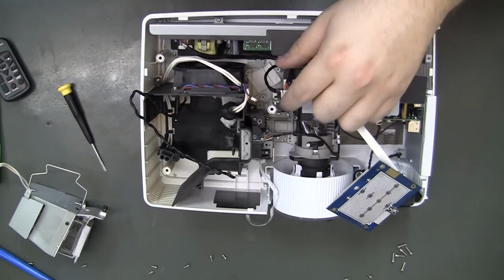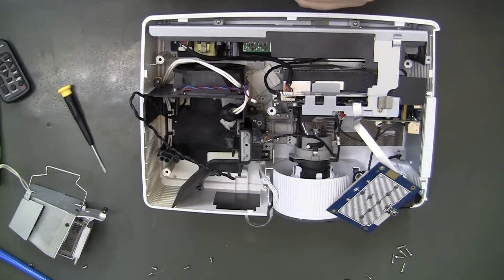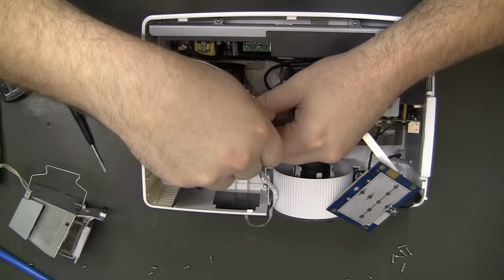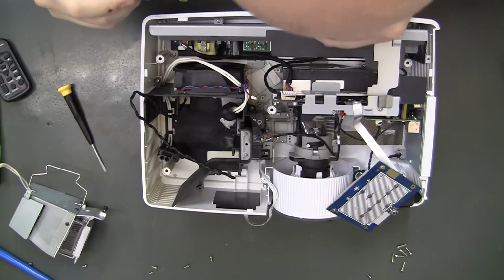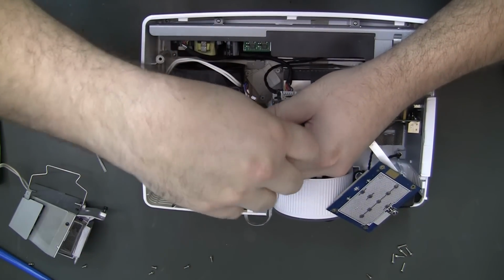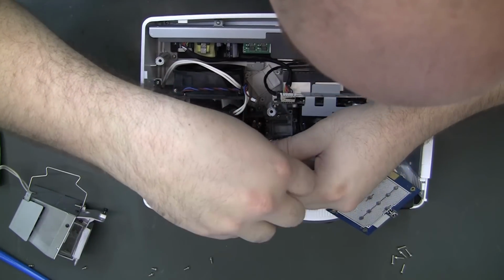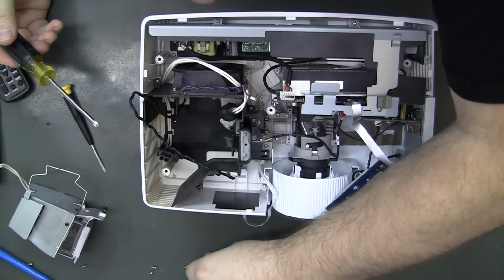Yeah, the other thing is there's a light sensor on this PCB right here that's also in the color wheel housing. Might be worth taking a look at. Keep it clean. You know, these mount screws over here are useless. The plastic is just gone around those areas. Only these 4 screws over here are the fine thread. Everything else is the short coarse thread screws.